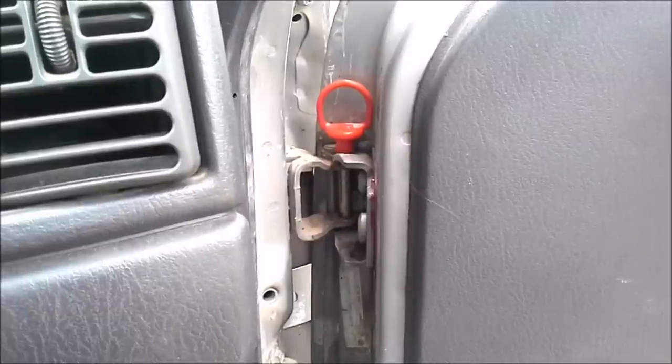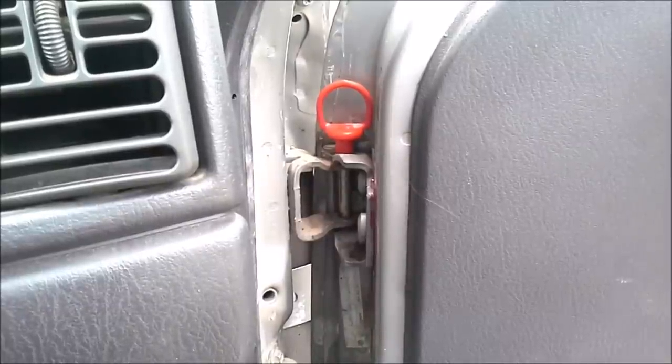I've got the hinges put back on and the proper holes drilled in them. What I've got now, if I want to put the doors back on the Jeep, are these pins right here. These pins are what allow me to either put the doors on — I just slide the pins in — or pull the pins and take the doors off. It makes it nice and easy: just line the hinges up, drop the pins in, and you've got the doors back on the Jeep. Here's a close-up shot of the pins in action — you can see I've got the doors back on with the pins holding them in.